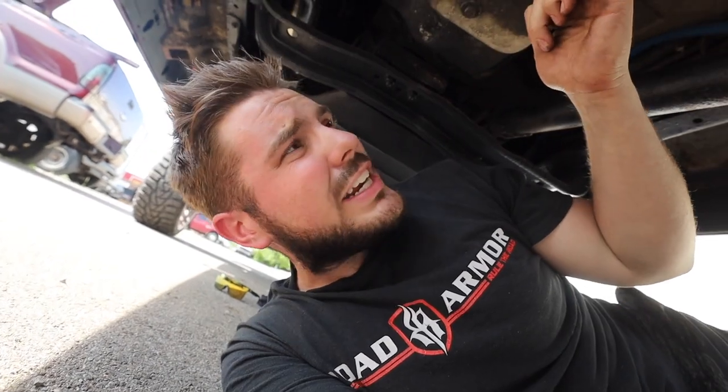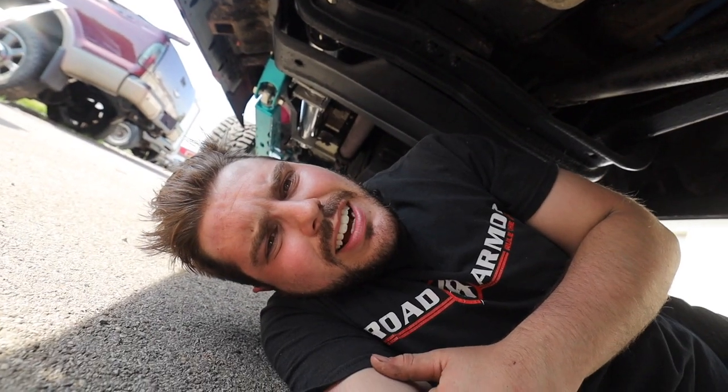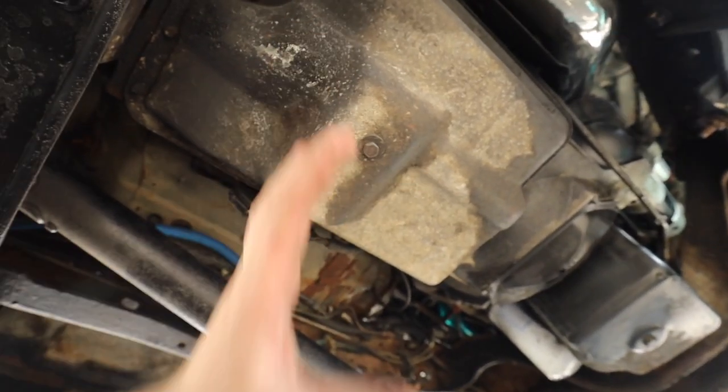Old trucks — it definitely sucks, but it's kind of part of the game. You deal with high-mileage, cheap, beaten things — you're gonna be repairing a lot to get them the way you want. However, old things are fun and easy to work on. This should be easy. If we need to fully rebuild this tranny, I'm this close to ordering a rebuild kit and attempting it myself, just because I've never done it and I think it would be fun. Looks like a bunch of 10mm bolts and a 13mm for the drain plug, so I'm gonna drain this, pull all these 10s, drop the pan, and see where we're at.